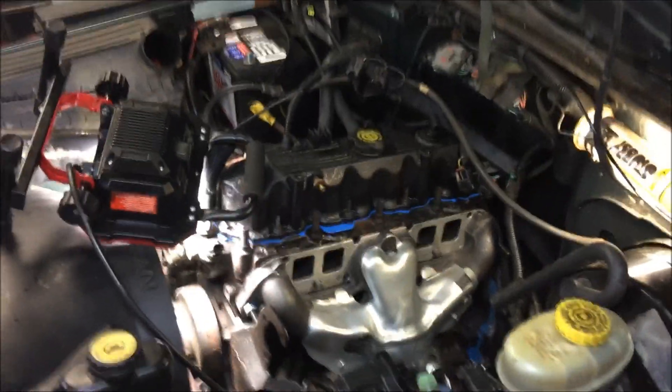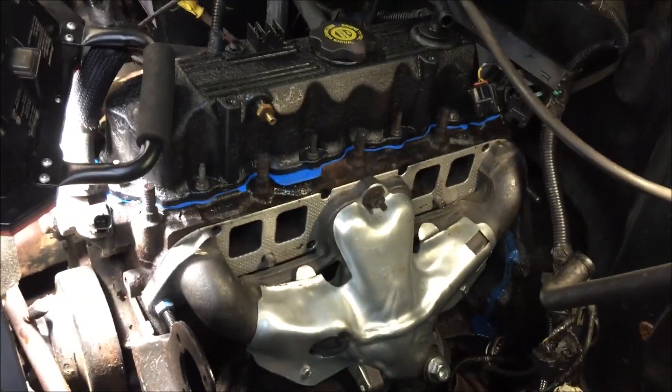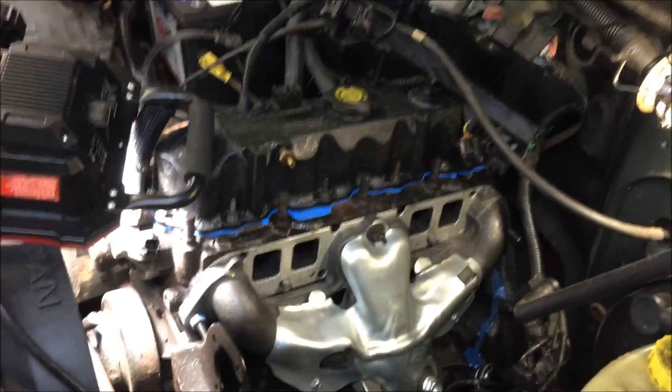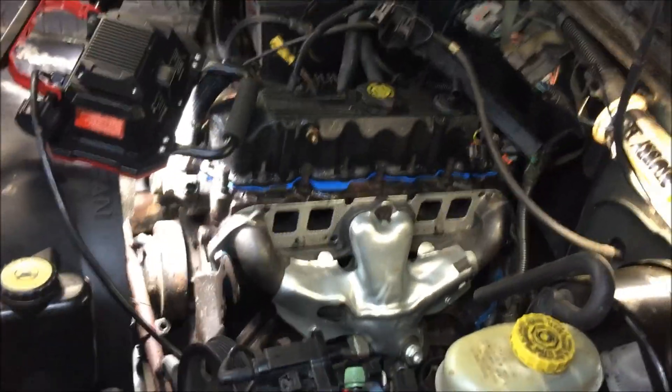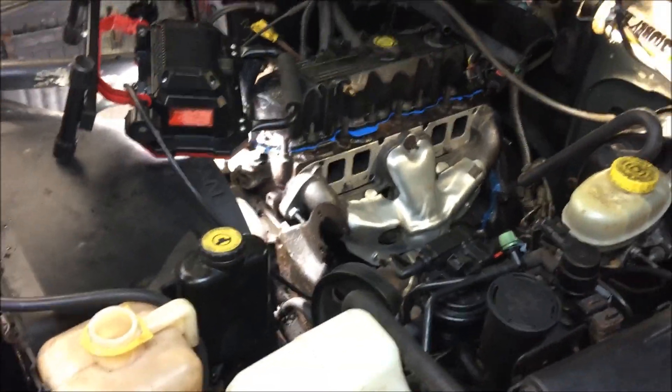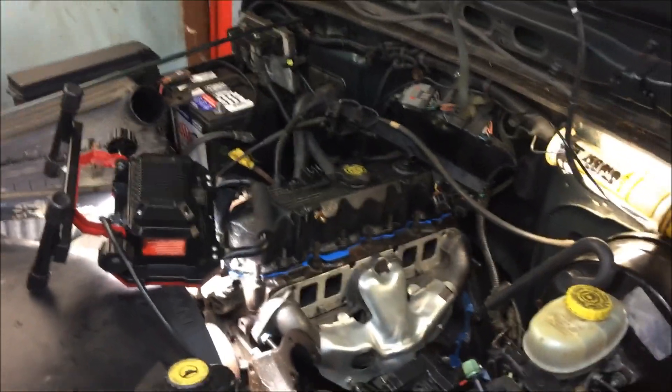One more update — I'm putting the exhaust manifold on. It's on there pretty good but it's not exactly straight forward — it doesn't quite line up correctly on one hole. Everything else is lined up properly, the spacers are inside so I can't move it left or right, it's sitting perfect. I just need to get out a drill and open that hole up slightly. So far that's been the only hiccup.